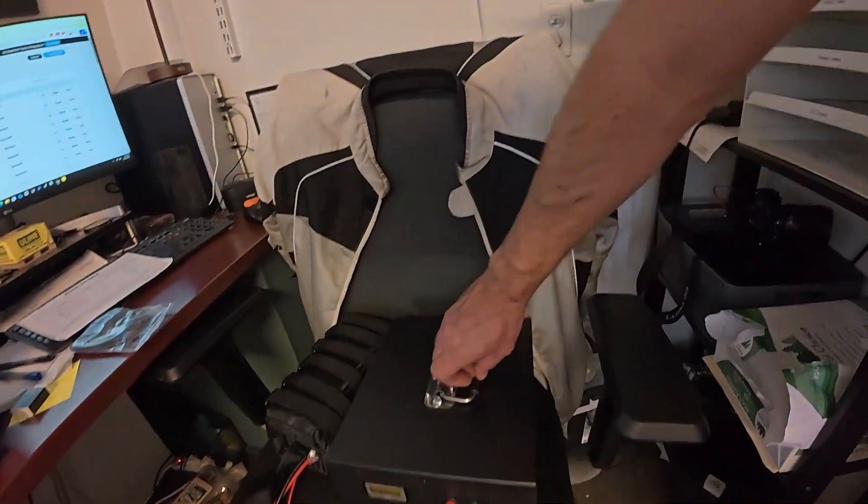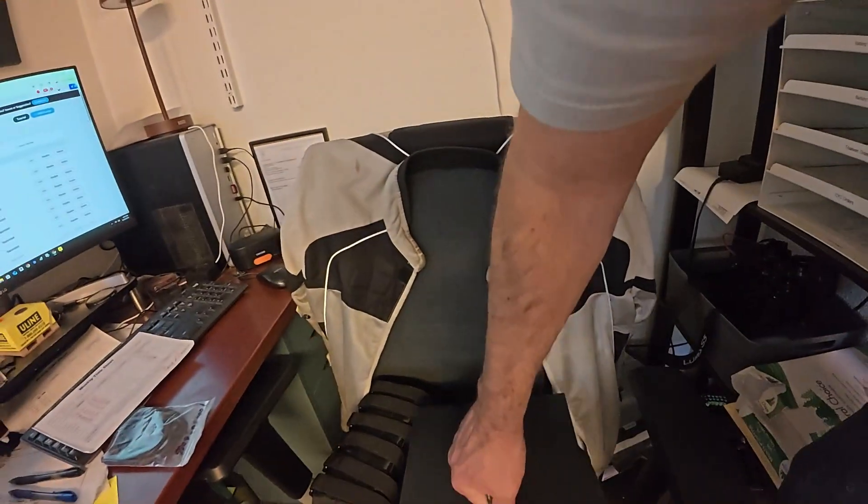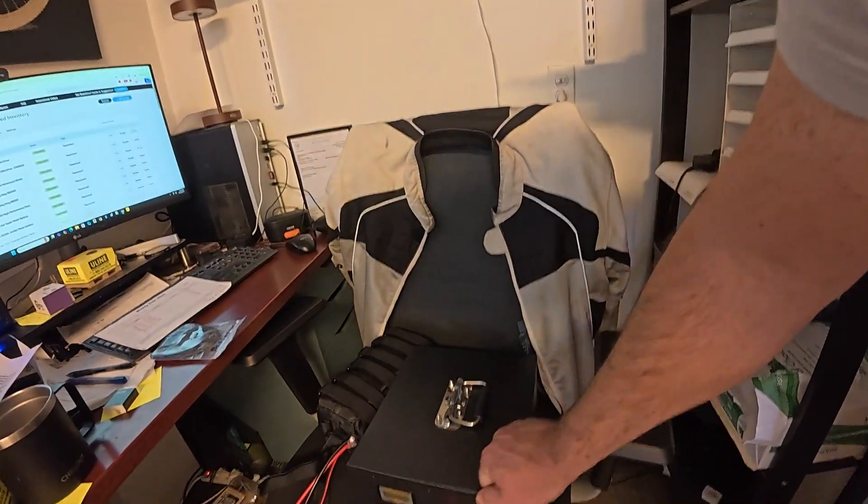This one has SB175 Anderson 175 disconnects on it, which are rated for up to 175 amps, and XT60 charging ports. This battery uses 50S cells and can output 150 amps continuous, which is about 15 horsepower somewhere around there. This one is replacing our outgoing 40 amp hour battery pack that had the same metal case with the carrying handle.